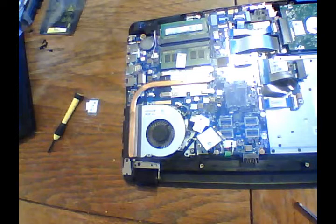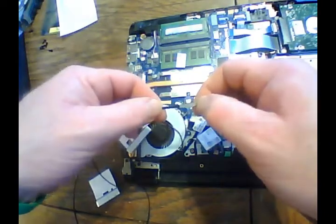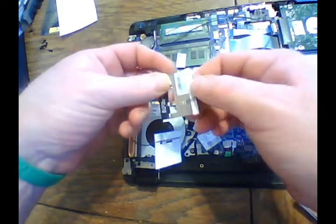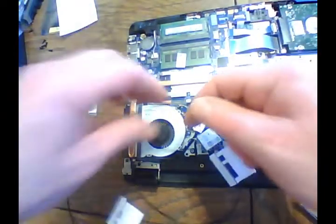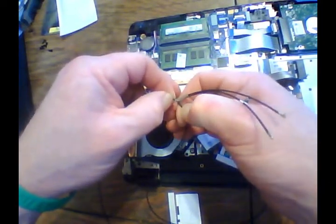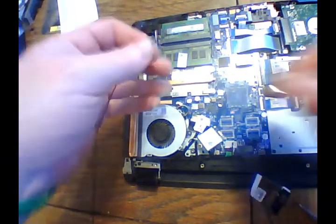since we're using the existing antenna wire, see, these two antenna wires are actually connected by a little bridge here. We're going to pull that apart. But you can see this here is actually double-sided tape, so we can tape that to the hood on our laptop later. So what I'm going to do is go ahead and see if I can pull those apart. All right, so I have taken apart the two wires, but